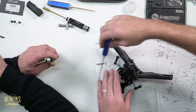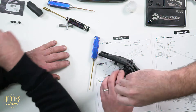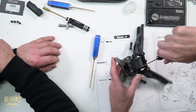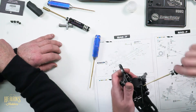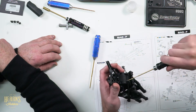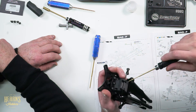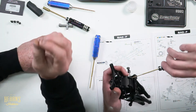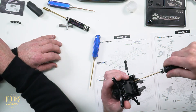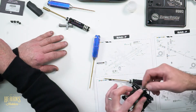What number is it tonight? This is episode four - this is the second build episode. I'm just going to do these up until they just seat. There's no reason, because I do have a grub screw in there to adjust the preload later. People do replace their gearbox cases all the time - you've only got to tighten them up until they stop. You don't keep tightening - it's not going to rattle loose. And I will adjust the preload on there later.